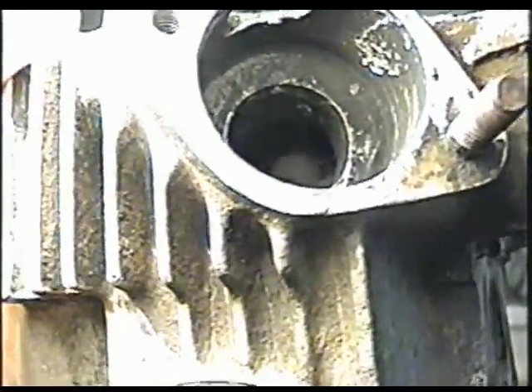I just thought I'd show you guys how to check your valves after you do a valve job on your engine. After you've got your head ready to put in, always check the valves like that, because you can go through all the work of putting the head back on, timing the engine, and so forth, and then you go to start it and it won't start — no compression because the valves aren't seating right. When there's a small gap the compression escapes out the valves, not creating enough compression in the engine for it to start. You're going to crank and crank and crank and it's never going to start. Thanks for watching, we'll see you next time.